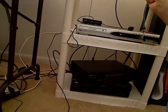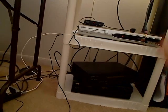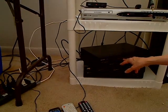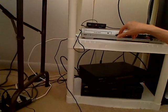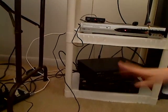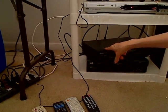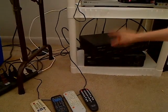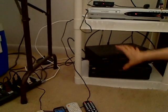Of course, you match up the yellow with yellow, the red with red, and white with white. It's pretty self-explanatory. What's going to happen is when you play a VCR down here, you're going to be dubbing off the picture that comes out of your DVD box. You can also watch television through the VCR box because you've got the audio-video lines connected up to the television. So basically, think of this down here as like an extension of your television set.